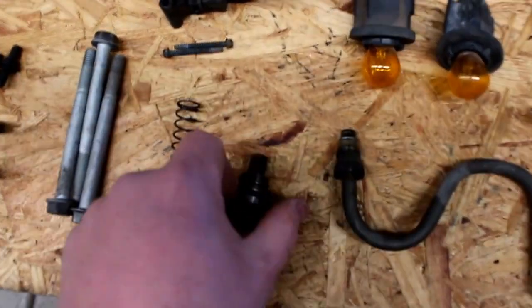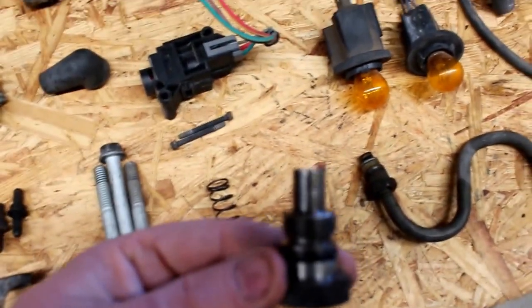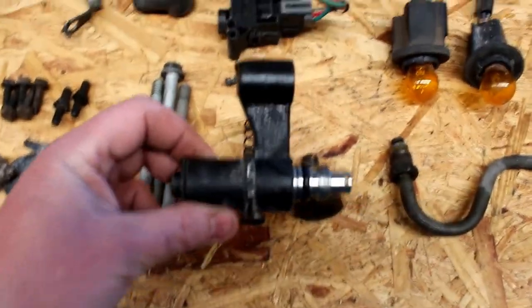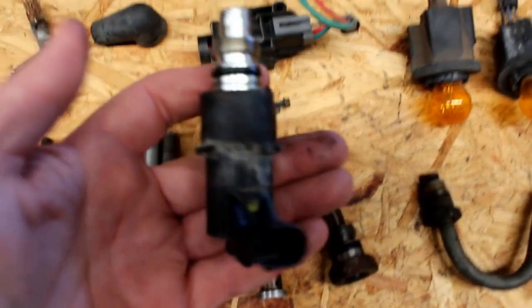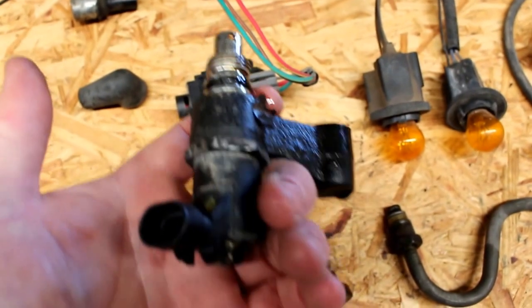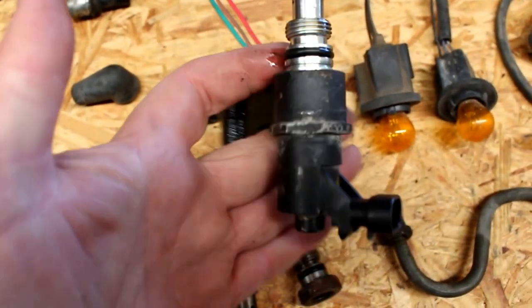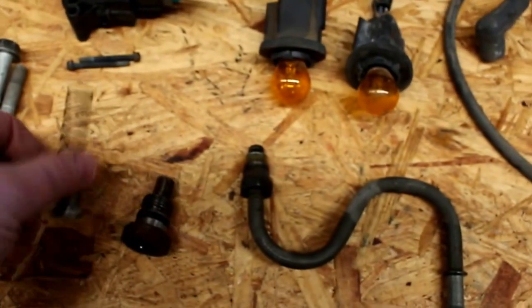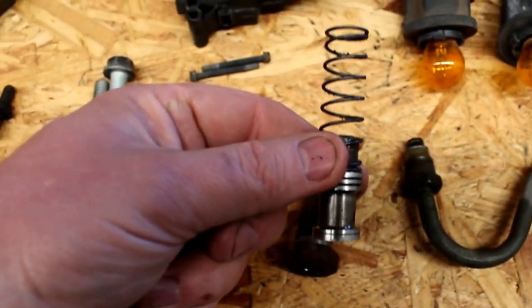This is the rear port for the back of the power steering pump. I needed that. The truck that I got it out of was new enough that there was an electronic part that I just dropped on the ground. So this is a variable pressure pump because of this electronic solenoid. I have no way of controlling that, so I just went with the old school. Fortunately, these pumps have been around since the mid 60s, so I was able to scavenge that.